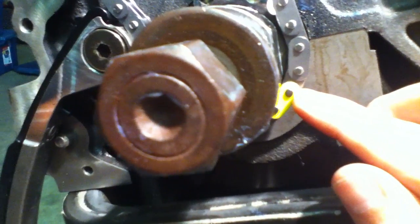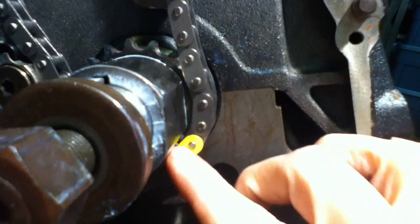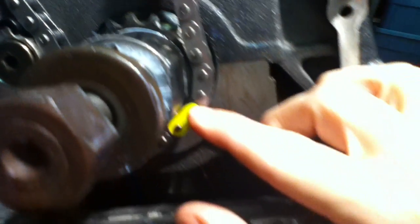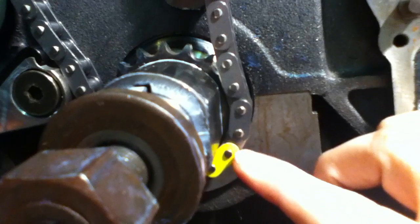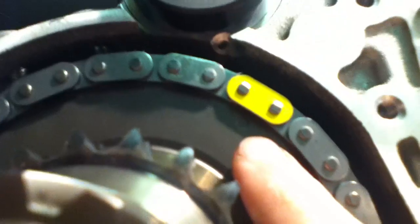You want the short side of the chain on your exhaust side of your KA engine. If you don't have a chain with any markings, I've been counting — not the links themselves, but the spots in between each tooth. Starting here: one, two, three, four, five, six, seven, eight... all the way up to 38, which would be right here. And that's where our upper timing chain mark is — so it's actually set up perfect right now.